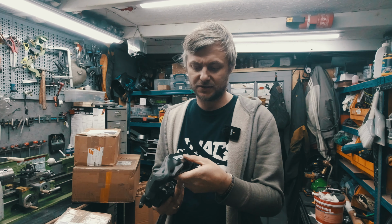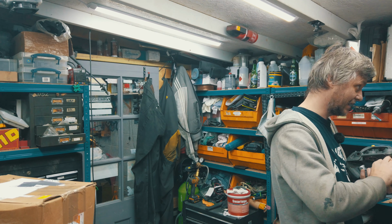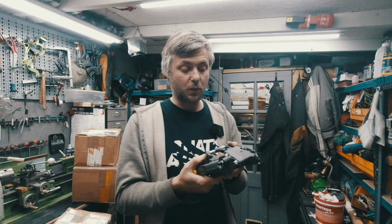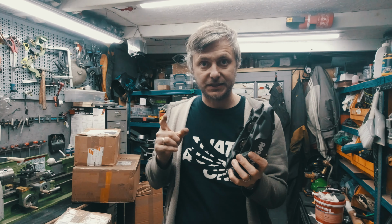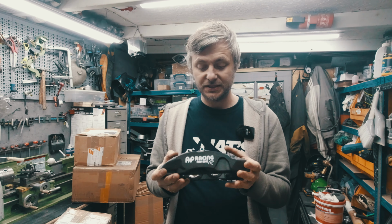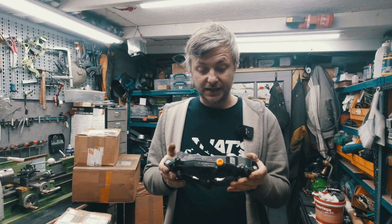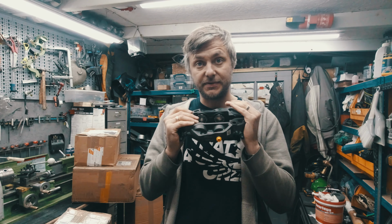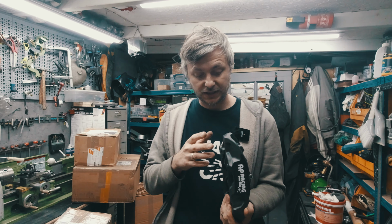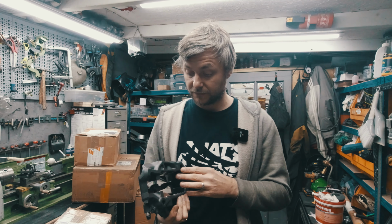No, actually, not even Pure Motorsport, because they don't make this. They supply this, AP Racing Pro 5000R. And I'll let you in on a little secret. Pure Motorsport now supply this complete kit for your Clio 172, 182. Basically, they use their own 300 mil disc. It's a two-piece disc, and they use those calipers, and they fit under 15-inch wheels. The reason they're selling this kit is because I asked Nick to make me a kit like that, because I wanted to use those calipers. So he designed and machined the special adapter that bolts onto the hub itself, the brake lines and everything. So now you can go and purchase this kit for your own car.